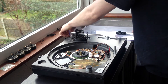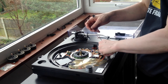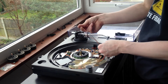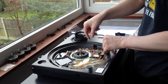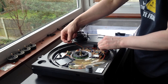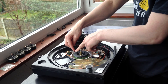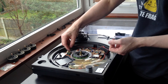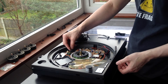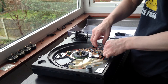Remove the top if you want to, and as you can see the cable is nicely through at the bottom here. Take the brown and orange cable with the connector on it, feed it back under the cables for the pitch control. You can only put this in one way as there are only two pins and one pin — a two-pin and a one-pin — so you can't get it the wrong way. If it's not fitting in properly, don't push it or you'll bend the connectors. Gently pop that on, a little click, and it's in.